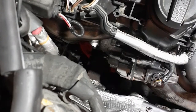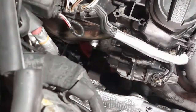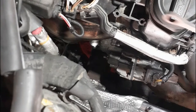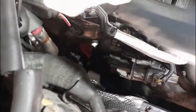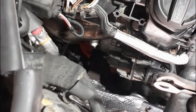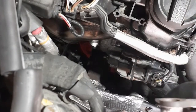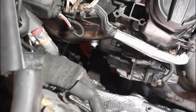Okay, so now we have to connect our exhaust from underneath, but I think we can connect our rod first, just to show you guys what we're dealing with. We have this rod here, but the pin on the actual wastegate is broken. So BMW cleverly designed this repair clip, which slides on like this. Once you get this over the turbo, it slides on like so, from underneath. It goes on the pin and it slides up. I'll show you guys once it's on.